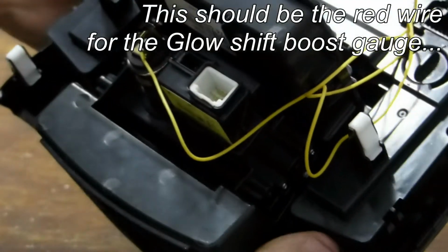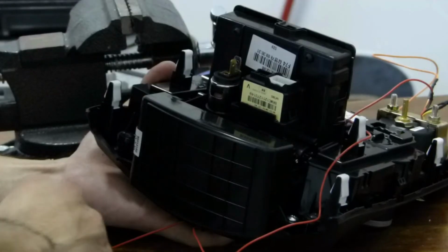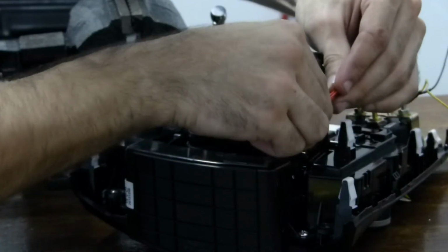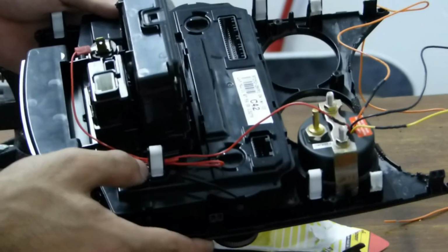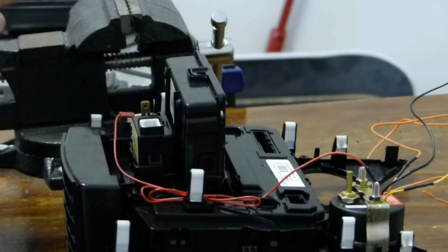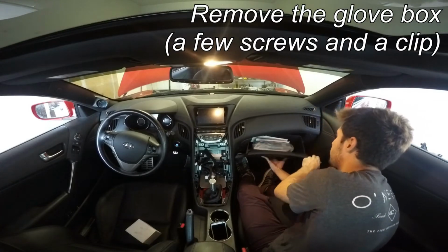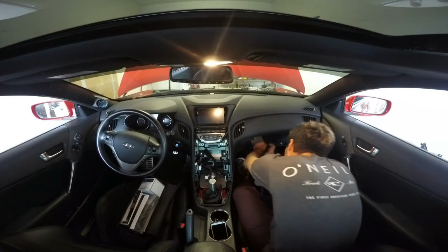You've got some gears in here. You're going to want to make sure your wires don't get caught inside there. Just snug it up. We're going to wrap up our extra wire here. Alright, nice and simple and clean, tucked away, don't have to worry about it. And that's our switched 12-volt circuit. You can just put that wherever it's out of the way.